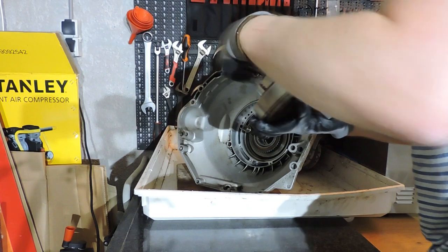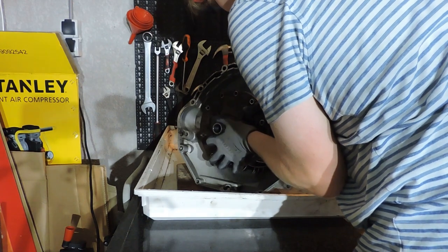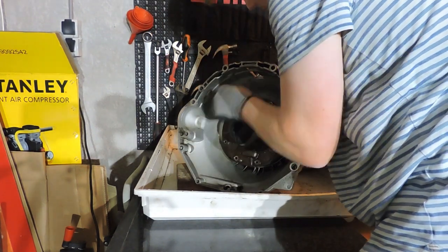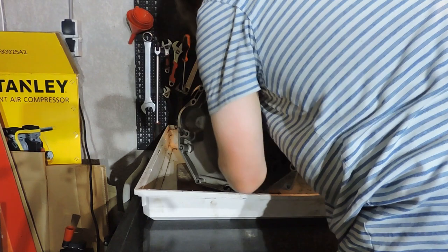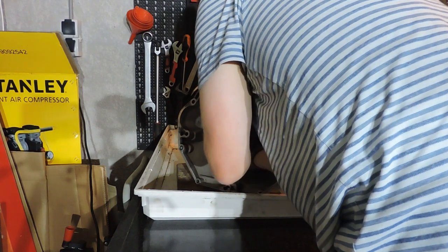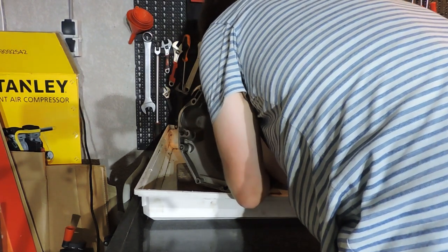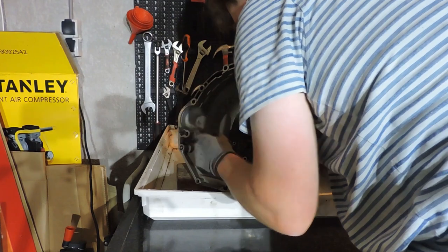What we're going to do is align the pump the way it should go in, which is roughly this way. With my eye, I'm checking that my bolt hole grabs in the threaded hole right there. And the moment we have the pump almost in position, the only thing we're going to do, as we did so many times, is twist and turn until the pump actually drops in. We are now twisting and turning and making the friction plates of the C1 grab into the sprag bearing that we just put in. And the pump sits flush against the outer area. So as long as you feel that there's a notch here, your pump is not properly in place.